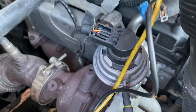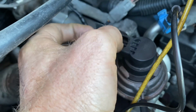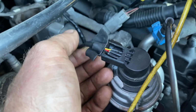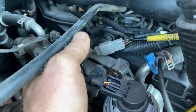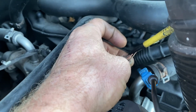Okay, out to our little turbo actuator. You can see someone has been in at the block connector that should be interior, and the top is broken off it. Maybe that was from getting pins, heat shrink or solder onto the wires. Don't know, it's neither here nor there. The block connector is gone off here, but there is another one in here, so it's easy enough for us to get at it. I don't know the wiring diagram on this, but I have 3 wires, so it's going to be relatively easy. We're going to have a 5-volt feed, a ground of 0 volts, and then a signal.